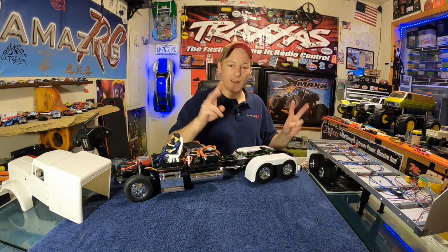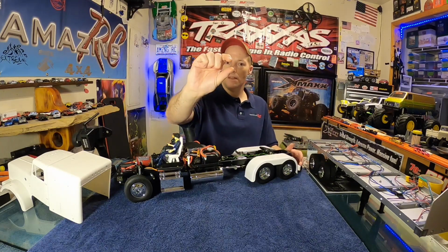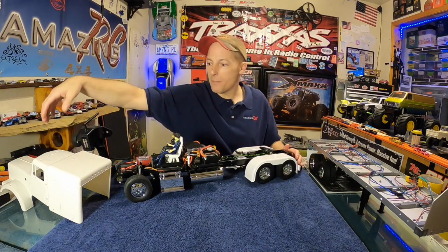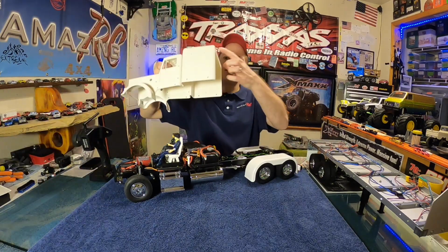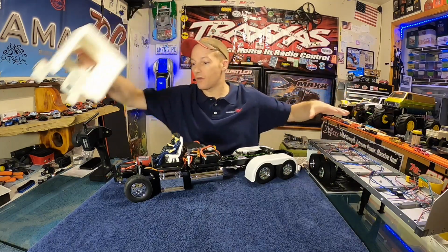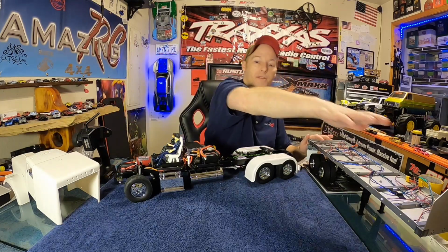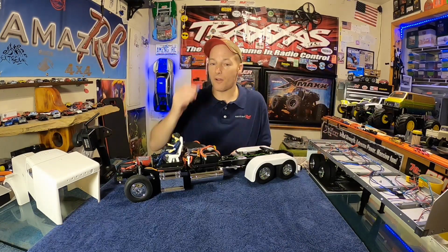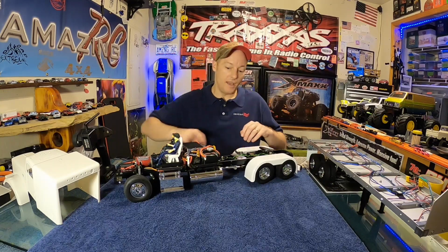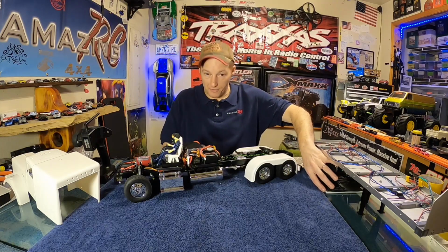I'm actually going to have two 10mm LEDs, big goofy bright white LEDs. I'm thinking about putting them probably in the back of the cab here to shoot over the headache rack of the trailer, or in the trailer headache rack itself, to light the entire top of the deck. All that should be able to be run off this, as well as two separate on-off switches. I should be able to run both 12-volt sets of ground effects lights.